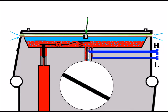But because we've lost the vacuum, it will no longer be drawn down and act on the metering lever, which will then act on the metering needle to allow more fuel through. So we've lost the fuel through altogether there. So all that will happen now is the metering needle will stay fast on its seat, and because that's fast on its seat, it won't allow any fuel coming upward from the fuel pump diaphragm area to replenish what's up there in the metering area.